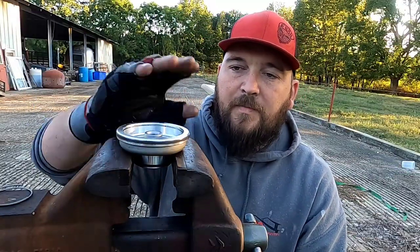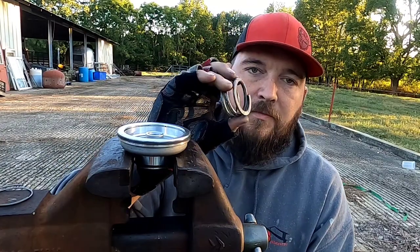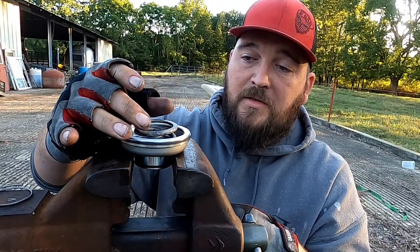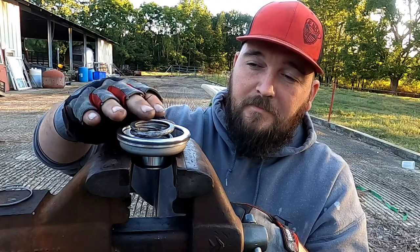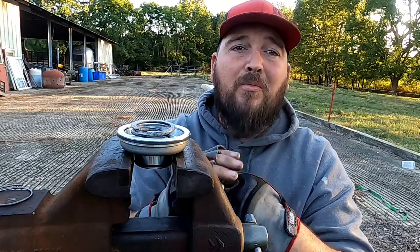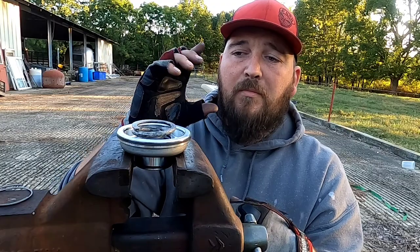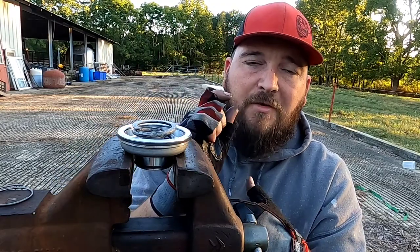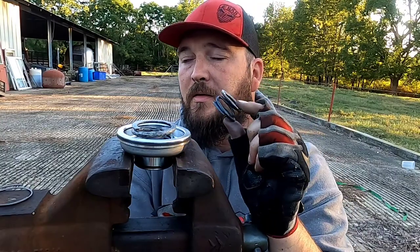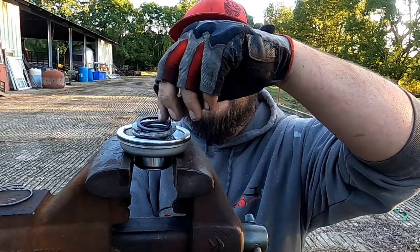This is the Corvette servo, and it's got a cap plate, and this is the spring that came in my stock servo. This spring, we then translate to the Corvette servo, but because this Corvette servo is going to have so much more pressure, it's going to be like a pow when it goes into second. We don't want that. We want it to hit, but we want it to be a softer hit. So the kit is going to be including two more springs that sit down inside there.